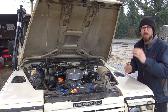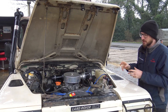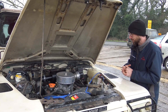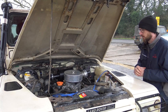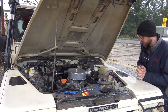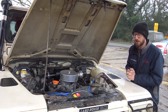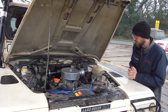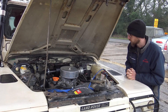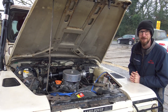We should have really filmed this prior to all this work. The next thing is the LPG system to look at on this. We've done an inspection on it — it's not on the UK LPG database and there's quite a bit to rectify: mainly pipework that isn't clipped or is inadequately clipped. Steve also found that the rubber-coated copper pipe had actually been resting on an exhaust manifold. Thankfully it was copper pipe and had just gone through the rubber coating. That needs moving, and it also revealed a hole in the manifold. So we've got that to sort out as well — undoubtedly there'll be another timeline on it, whether before or after the next workshop update.